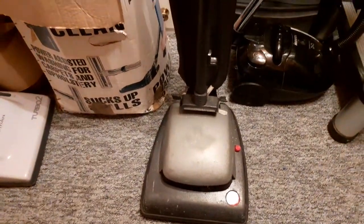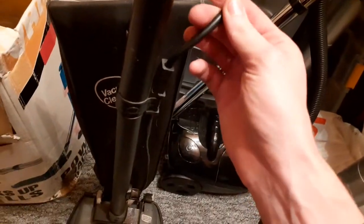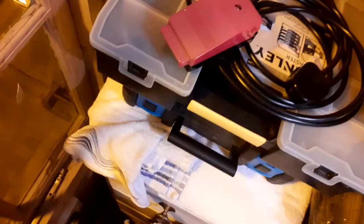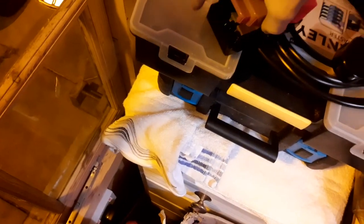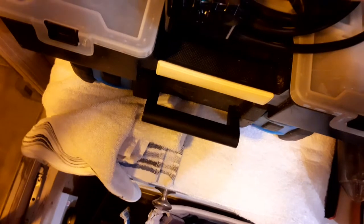The cable is black — this machine was made in 1992, so it would have had brown and blue cable by then, but it's been chopped off. I've always wanted one of these and finally bought one: a Quick Test. Basically, if you've got an appliance you want to test, you can use one of these — it saves you putting a plug on it. You put your live in there, your neutral in there, and your earth if you have one, shut the lid, plug the Quick Test in, and you can test your appliance without fitting the plug.